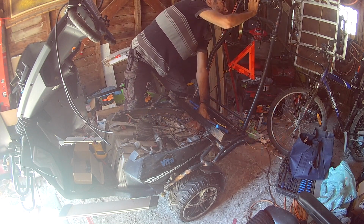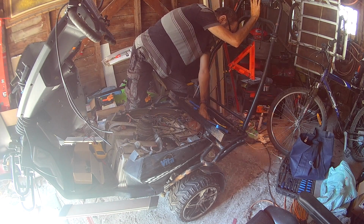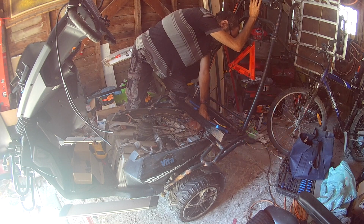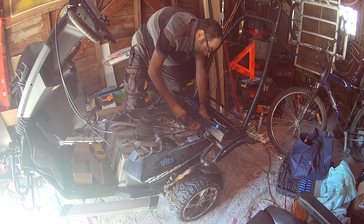The first thing I decided to do was hook up the switch for my strobe light on the back. It's got 3 wires: positive, negative, and a third trigger wire, which you ground to change the flash pattern. First I had to determine which wire was which, and even grounding it by hand, it just didn't seem to want to work properly. So I ended up hooking it up to the switch anyway and testing it, and the switch on the back had no more effect than the one at the front did.